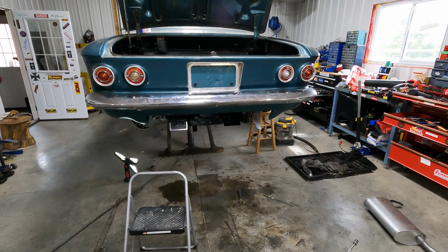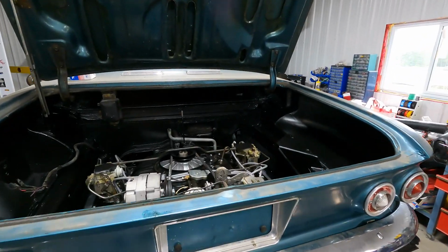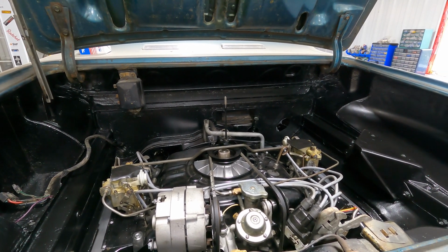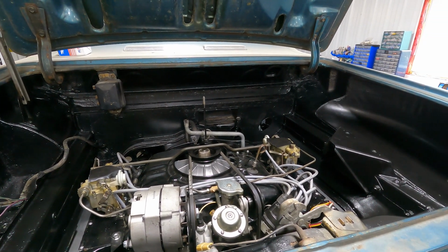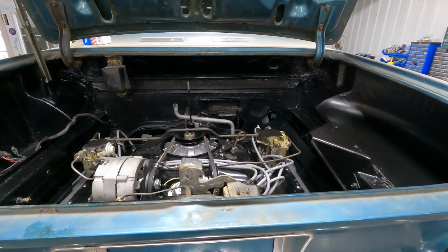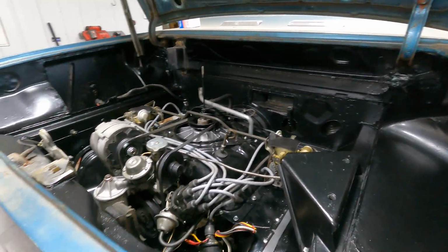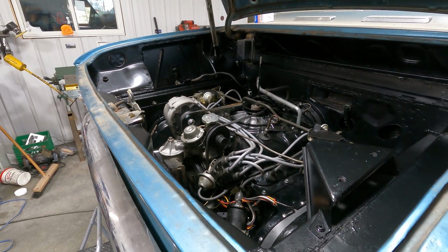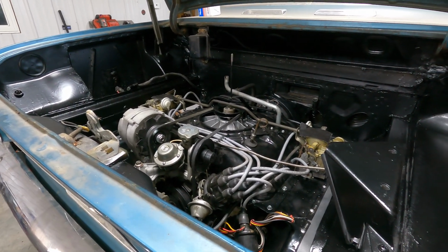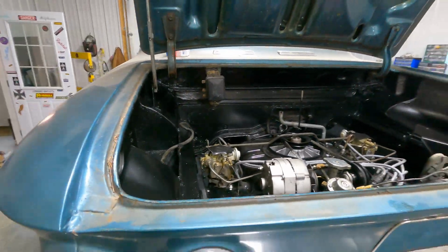Fortunately, it's not a big mystery of, hey, let me put this engine in and maybe it'll run, maybe it won't, because I've already had it running and I've already set the valves and I already have it kind of dialed in, and the carbs and the timing, as best I can anyways. So it should be pretty good in that respect. So I feel confident being able to just go ahead and assemble the rest of the stuff, knowing that I've had it running. And running it on the table or on the stand is a good idea. At least then you know what you're into.